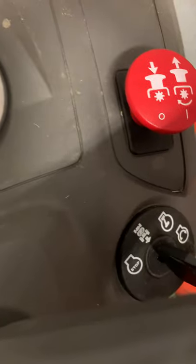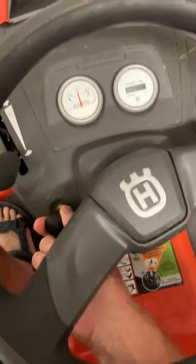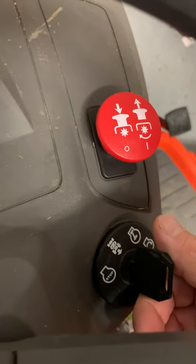You have your cruise control — I do not recommend cruise control for anybody, but they put it in here. Your ignition switch: you turn it on, get to this point, and crank it up. Your choke is right here by the steering wheel. You turn on the ignition, crank it up, give it a little bit of choke, then turn the choke back off.